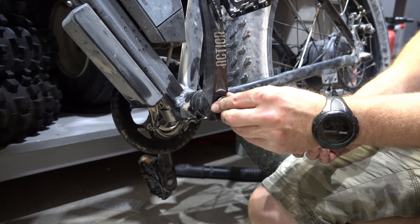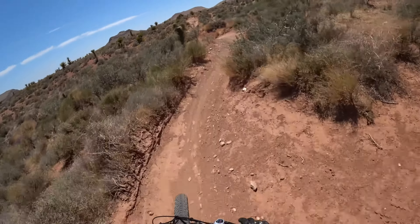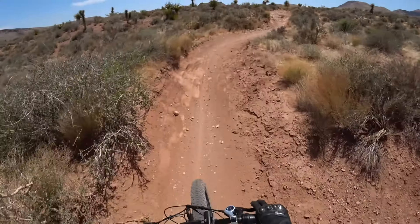This is super tight right now, and hopefully the Loctite is going to hold it in place. I like to put my sensor a little bit high up here so rocks don't hit it — that's how long the cable is anyway. Now we'll get ready to put the crank back on. Make sure you match it with the right side on the other one, and this bolt should just crank it into place. Some people hammer it in, but this bolt is meant to just get it into place. Cool, we're ready to go.